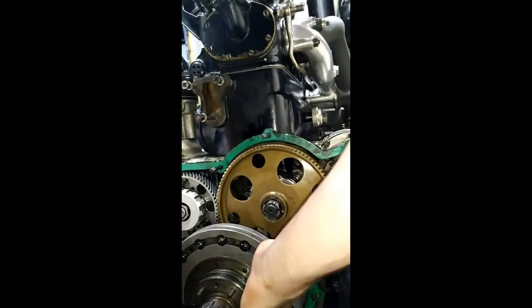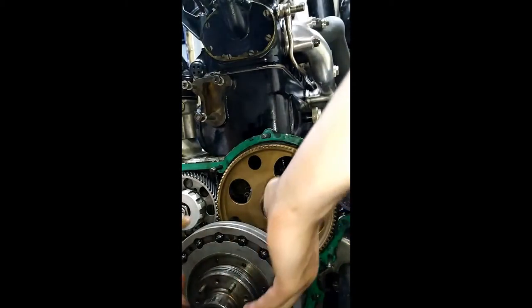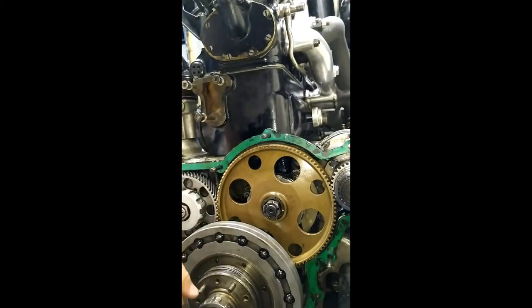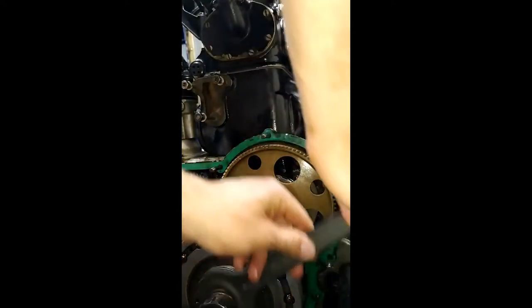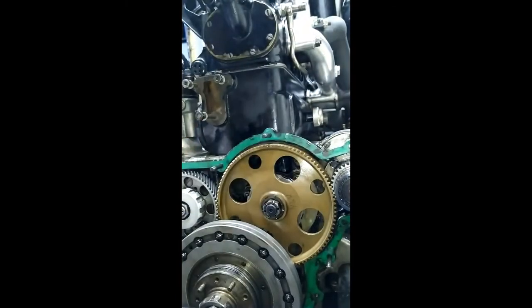This is what you are about to see. As I insert the damper, these gears move and you will hear a click — that is just the damper sitting on the crankshaft nose and hitting the woodruff key. Now that your gears have moved, the next job is to take a spanner and tighten up the starting dog nut. You will see that the crankshaft slipper drive will start to engage and bite and then it will actually draw in.